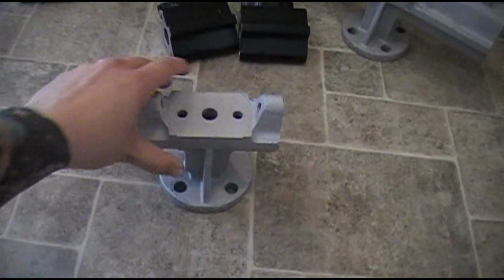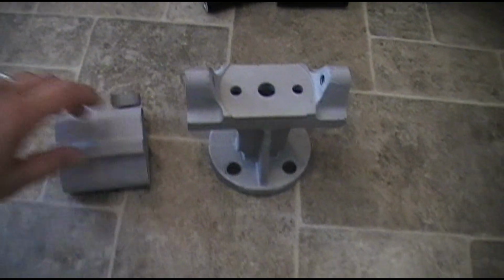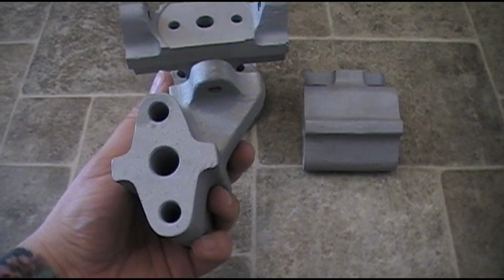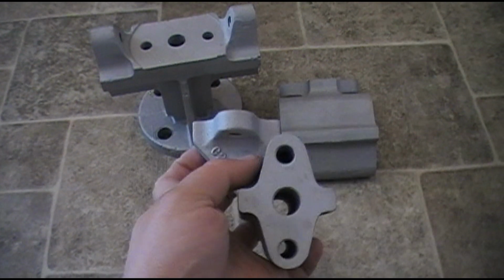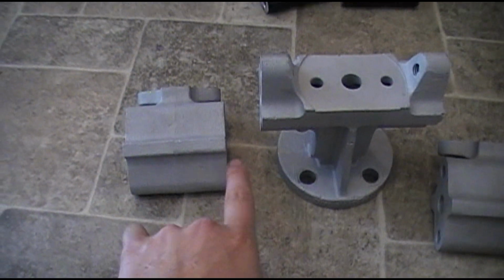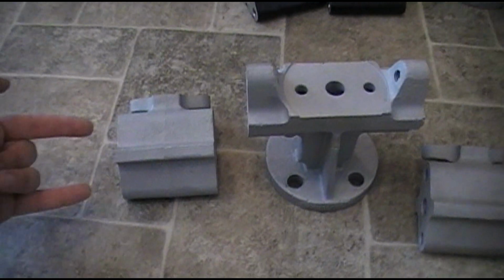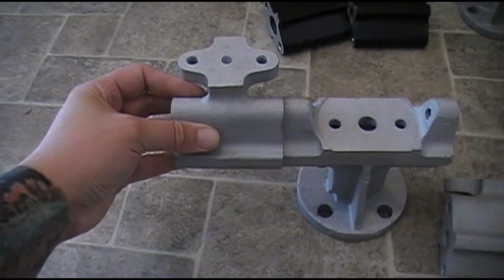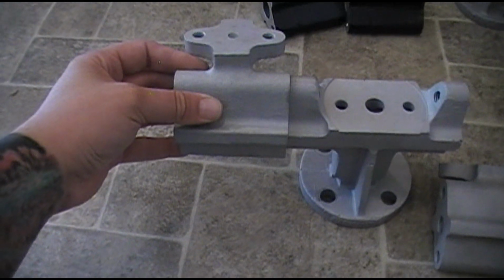And so, what Dean Ellsworth and Nathan Erskine did is they took the low-profile 3-chime manifold and they added to it these extension wings. Now, these are separately cast pieces, and each has the P5 mounting foot profile on both sides with an additional mounting location on top. And the idea is you put a gasket in between this extension piece and the manifold and slide extra long bolts in through this way, through the bell that bolts onto the end. And it bolts together like so, and gives you an additional horn mount on each side, turning this low-profile 3-chime manifold into a low-profile 5-chime manifold.